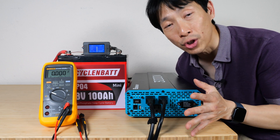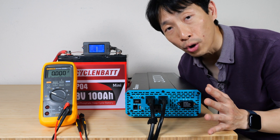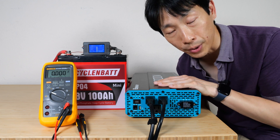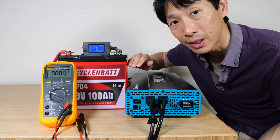We'll have to wait until it cools off naturally before it re-engages itself. The battery will prevent charging if it's below 32 degrees Fahrenheit — usually batteries will get damaged if you charge when the temperature is too low. So if it's ever too cold, you need to warm up the battery first before you can start charging. When it's discharging though, it can operate between minus 4 and 140 degrees Fahrenheit.